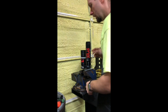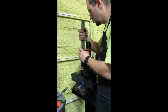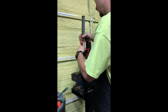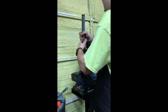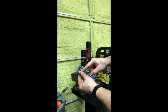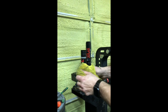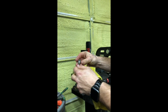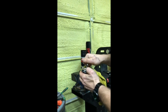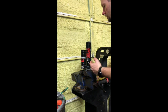Now I'm going to pull the IFP with my tool — made out of a tie rod end, like I said. Just hook it in there and slowly pull it up — this stops it from squirting oil everywhere. This is your internal floating piston. There's a bleeder that uses a SAE thread Allen — it's eighth-inch SAE, not metric. You take this out and there's an o-ring behind it — that's how you bleed it when you put it back in. That's the o-ring and the piston band. The whole shock is now open.